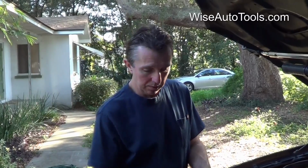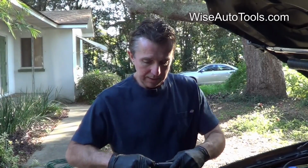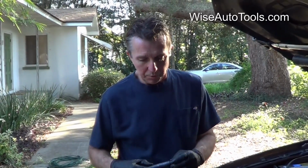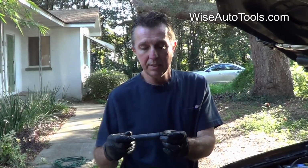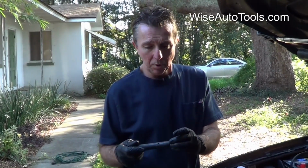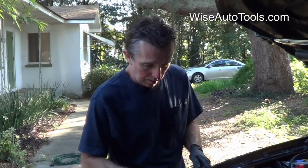Loctite will adhere better. And I've got the setting ring tool, which goes on to the end of the installer right there. If you're using fully threaded inserts, like those that come in the 5600 kit, you want to leave the setting ring on the setting tool. If you're using a partially threaded insert, then you would not need that extra little ring there.